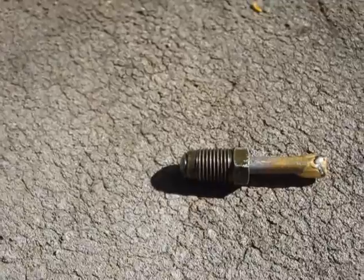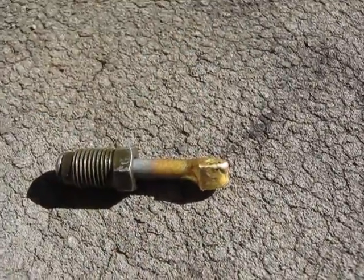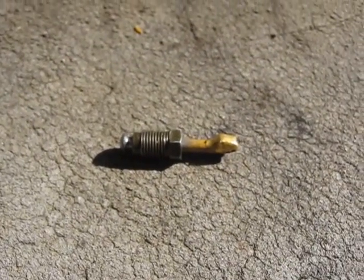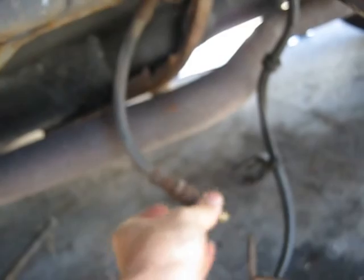It's basically just a couple of two-and-a-half inch long pieces of brake line with a proper flare on the end — in this case it's a bubble flare — and the other end I fold over on itself and braze it shut. So you've got a flex line sitting like that, you just screw it in the end and that way it stops your brake system from dripping and losing all your brake fluid. These little plugs come in handy; when you're done the job you get them back. You can make them out of an old rusty line since they don't have to hold any pressure — it's just a plug to stop the system from dripping while you're working.